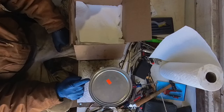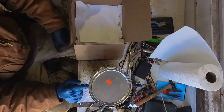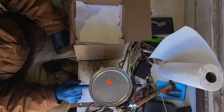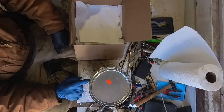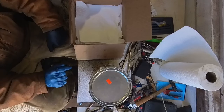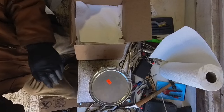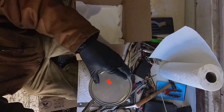Cast iron and low alloy steel should be coated with penetrating oil such as Berryman Easy Does It, part number 1612, after rinsing to prevent flash rusting. For best results and longer cleaner life, remove loose dirt and excess grease before soaking parts. Chem-Dip. Okay, so hopefully I didn't overdo it because I've been in here for over 12 hours.